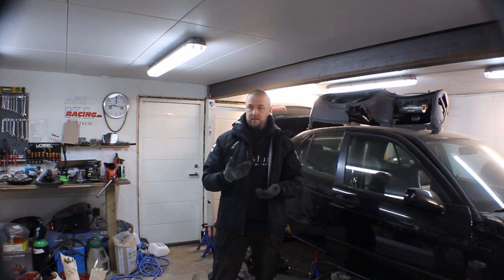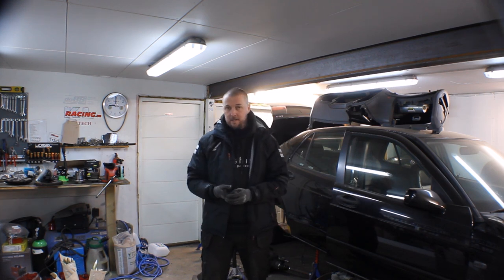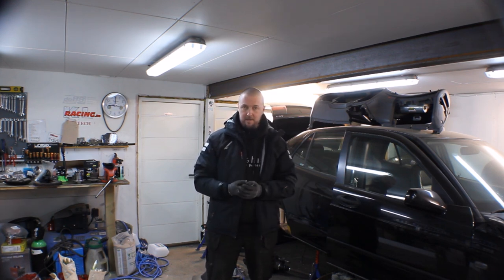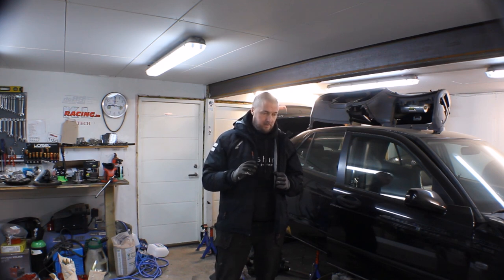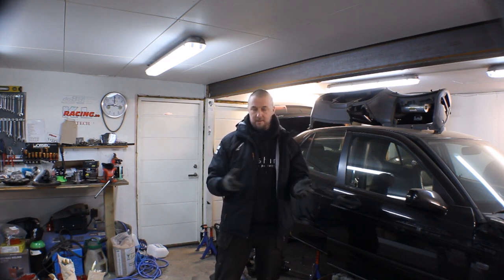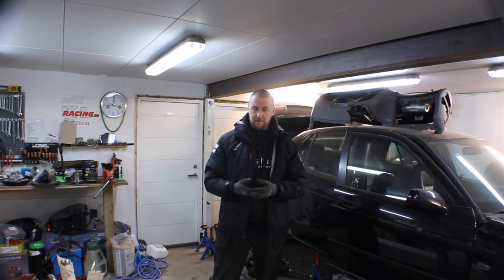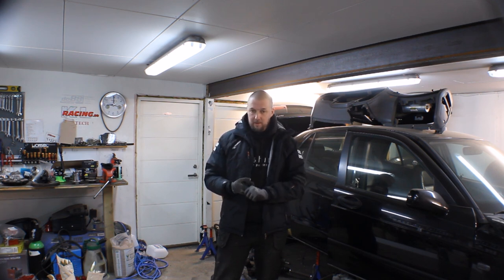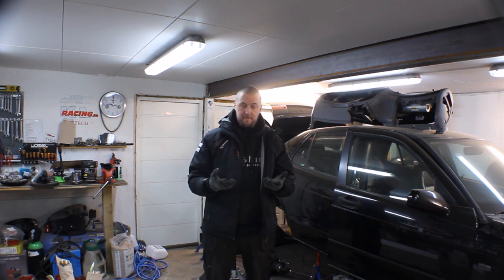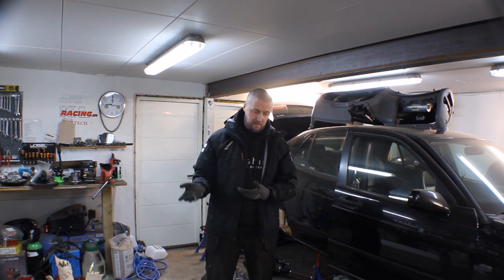So when I got home, like 3 days after I bought the car, I did a stage one tune. We upped the power to 300 horsepower and like 500 newton meters of torque. When I went out and did a third gear pull, it started to stutter when it was accelerating. My first thought was, oh, it's misfiring, because the coil packs and the spark plugs are a common thing on the V6. So I did change all of them, because some of them were really old.